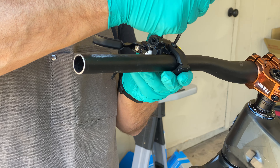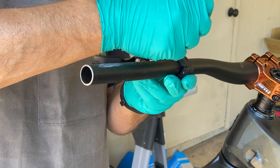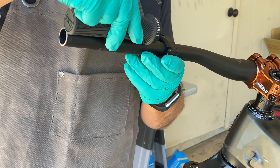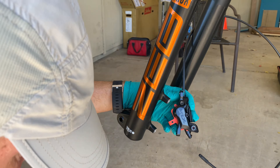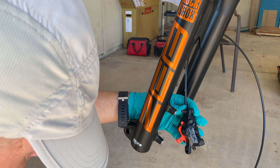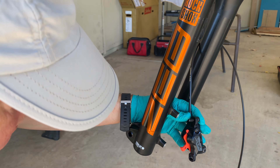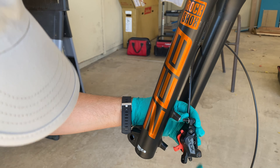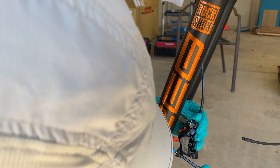To install the front brake, I first put on the brake lever. I want it close to where it should sit on the handlebar, so I'll use my grip to get the general proper placement. Next, I install the caliper onto the fork. The RockShox Zeb is set to work with 200mm rotors. However, the Shimano rotors are 203. To make up the difference, I add these washers that are 1.5mm thick.